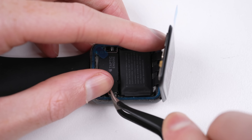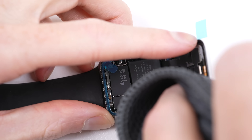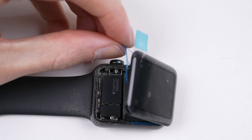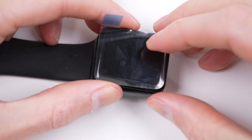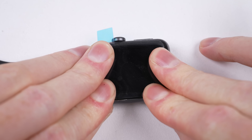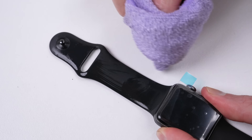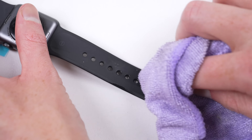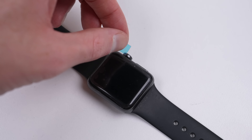It's amazing how a quick and easy job ended up taking longer than you thought, as something didn't go quite right — and that's definitely the case here. But the good news is we resolved it and the watch can now be closed up, about 35 minutes after we began. After peeling back the remaining protective film from the adhesive, the display can be aligned and pressed down into position, attaching it to the frame of the watch. Now we can reattach the missing band and give the watch a thorough cleaning using some isopropyl alcohol and a microfibre cloth.